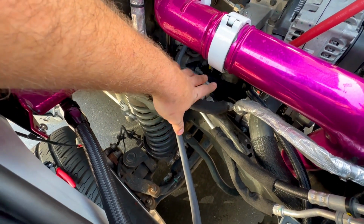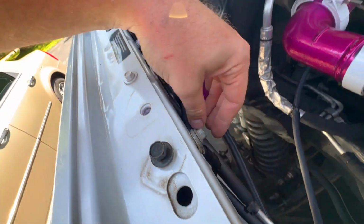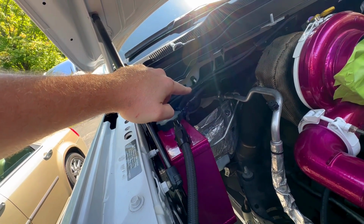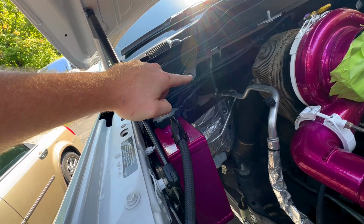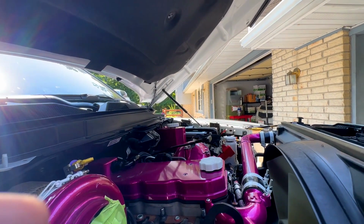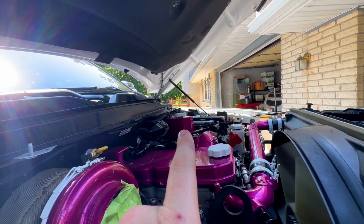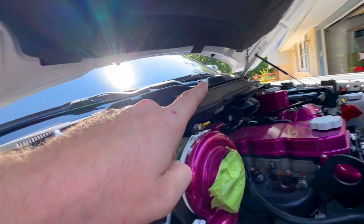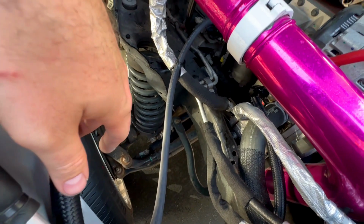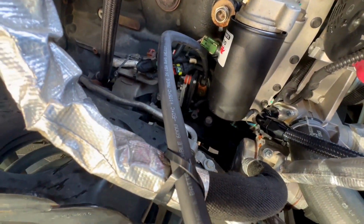When this goes away, we will address how we're going to do that. But the battery cable comes up here, runs along, ties into the existing wire that was coming out of the cowl right here. This was a power wire, but I actually turned it into a ground wire by taking it off of that terminal and putting it on that terminal. It's just the one wire, which turned into a ground, and then it runs all the way around here. Instead of adding on a bunch of extra and worrying about where to go, it goes right back to the block where it originally was, down there.